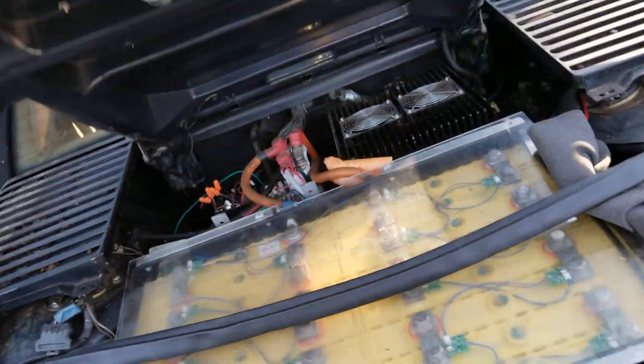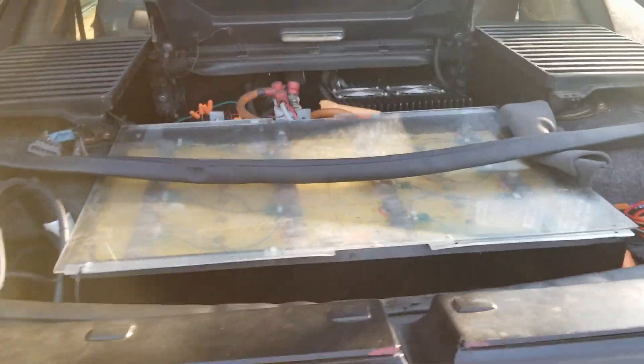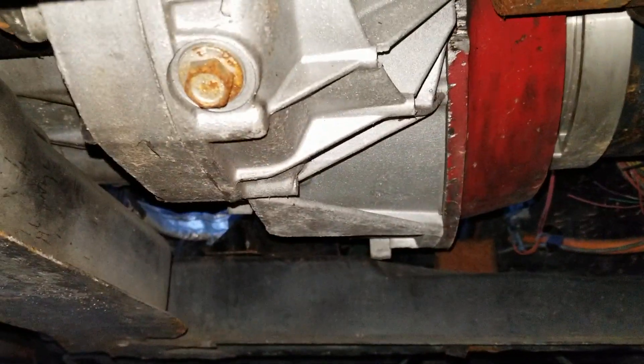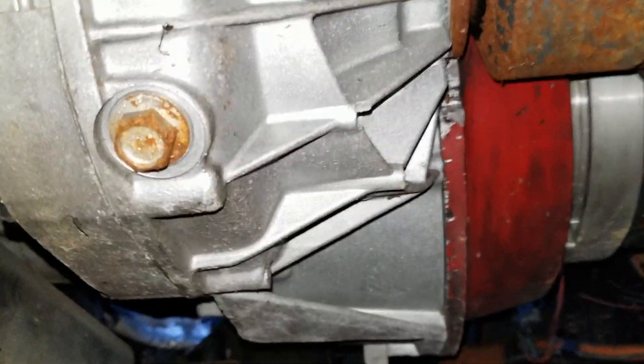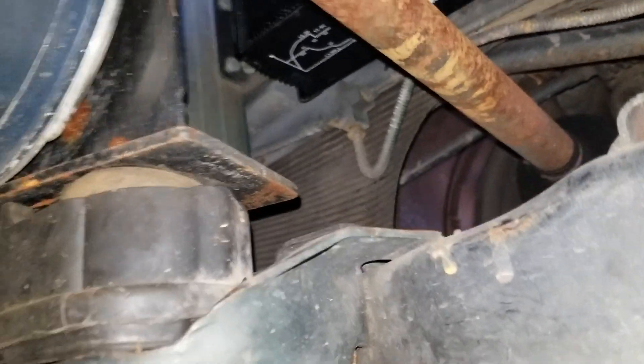Let me give you an example. This one is electric, and they don't throw out the whole car — they just change it. The electric motor is mated still to the transmission. The blue barrel is the electric motor, the red is the adapter plate — that's not stock — and the silver is the transmission, which is stock. That runs the shaft to the wheel. Those are stock parts. You want to leave it as stock as possible. It's a big mistake a lot of people make — they want to tear apart the whole car.